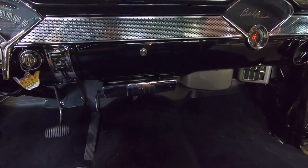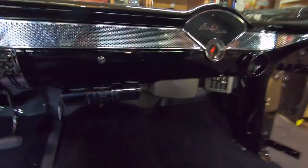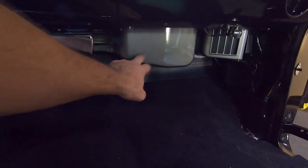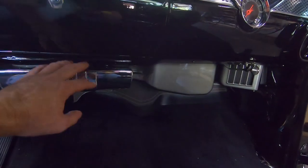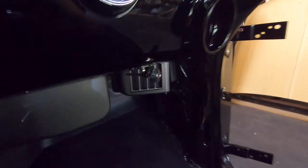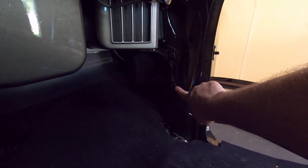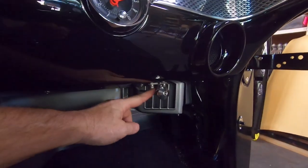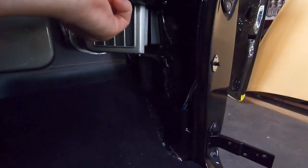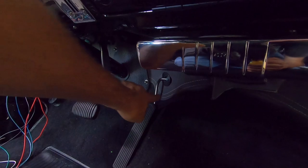I used — I think it was 2006 Honda galaxy gray metallic or pearl — base coat, clear coat — as my accent color on a lot of this stuff. It very much reminds me of the original gray hammer-tone finish that would be on this. So I used that accent color on the cup holder assembly, the heater box, and my screens for my kick panels for fresh air into the car. I actually welded square nuts on both sides so they take 12-point 10-32 ARPs to hold the screens on. I also used that accent color on the brackets for the cowl vent pull knobs and on my pedal assemblies.